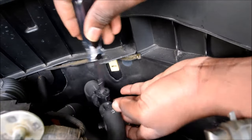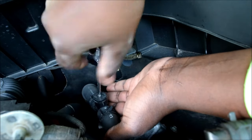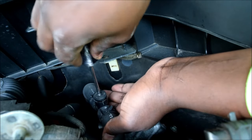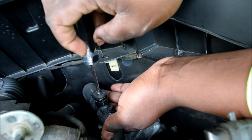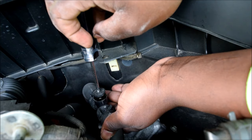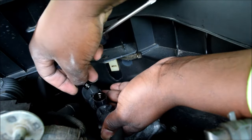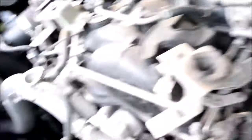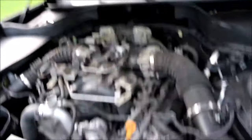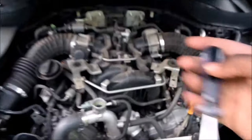Let's see what comes out from the bleeder. It wasn't that tight. You might hear some gurgling — listen out. Okay, this one hissed but no fluid came out. And on the other side — this one gurgled and burped and popped, and now there's no coolant over here. All the coolant is now taking up that space.